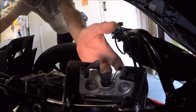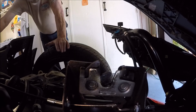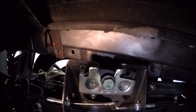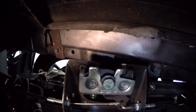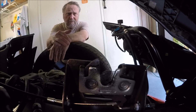We're trying to point out that if you had a failure of this cable to pull these latch releases, you could pull this down — you'd have to get access to it somehow — and pull it back, and you can manually release it. You're not going to be able to do it from the outside because the pivot point is going to cover this area, so you're going to have to get from up underneath to get it. Let's see how this operates and how that latch works when we release the hood. Perfect, looks good — and it looks like it did. I can't pull it. I'm going to release it. Did you see the cable move? The back one's released — now I'm going to open her up. There we go. That's the latch system for these hoods on the Polaris Slingshot.